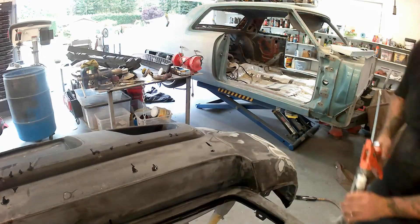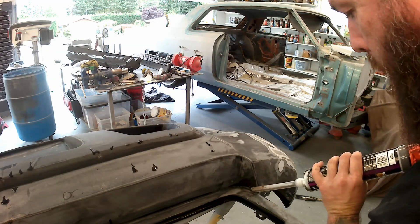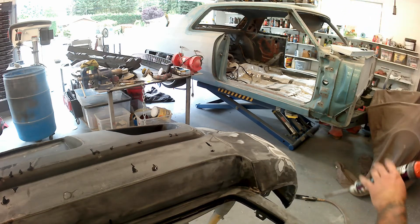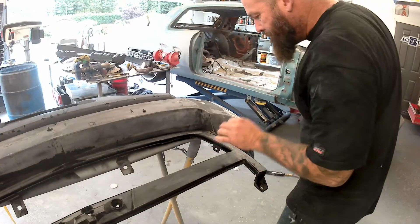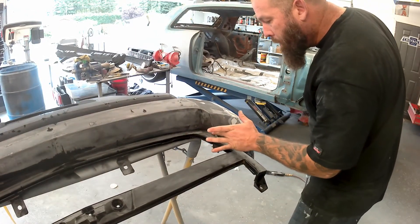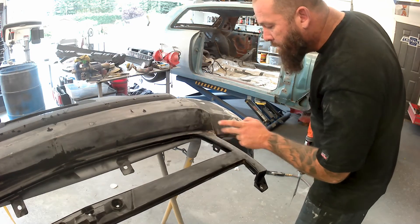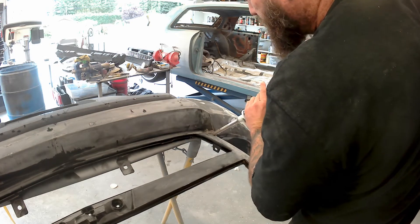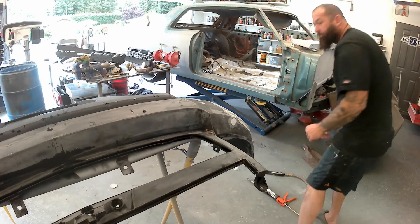I should point out that you do the outside of the crack as well once you've got the inside done. I did that on the side rip, and now we're going to do the one up by the grill. You need to force it in to get it into those stitching holes, then smooth it to a decent curve to fit inside. We'll go back and sand it — the stuff sands great. It's a pretty remarkable product.